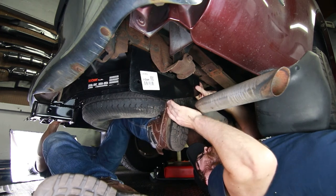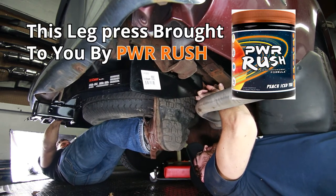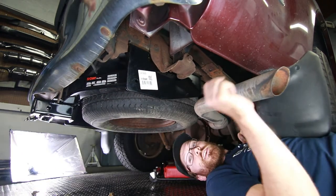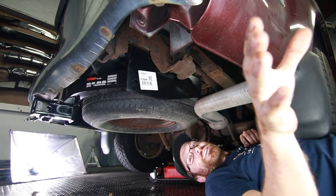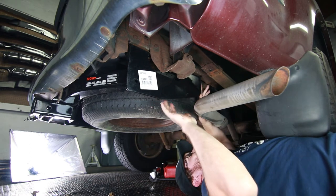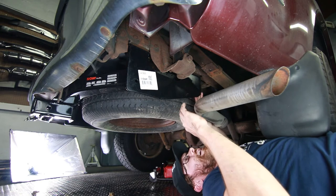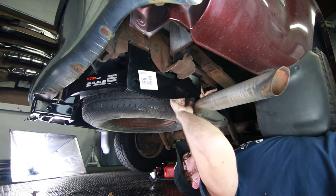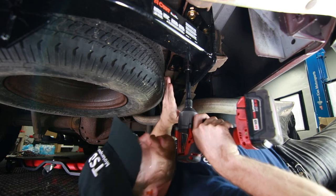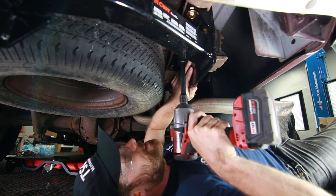We're very close — got it. Definitely bring someone who can leg press a lot for this job, because it seems like either the frame was twisted at some point, or the hitch is designed so that the back comes together a little bit and we had to separate it. Once we did that we were able to push it through, but it did take a lot of force. Now I'm not going to fully tighten any of these yet — I'm going to go around the hitch and evenly tighten them up so we don't get any weird twist as we go.